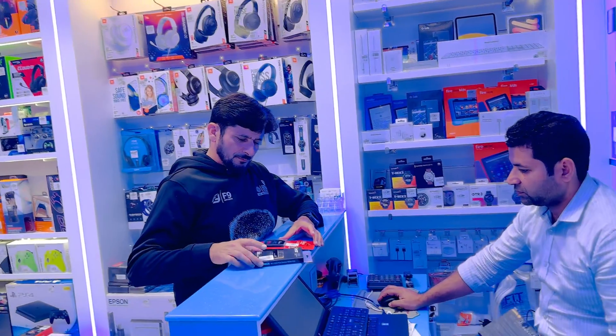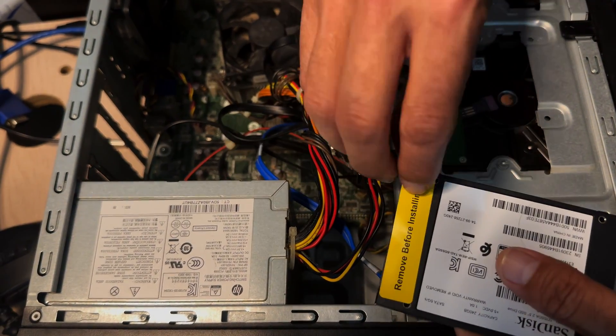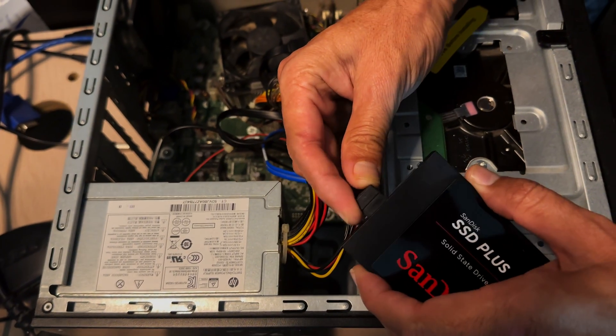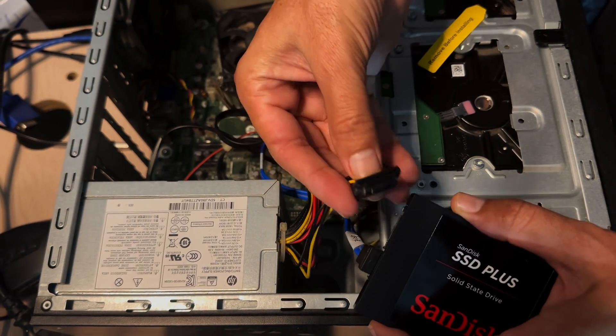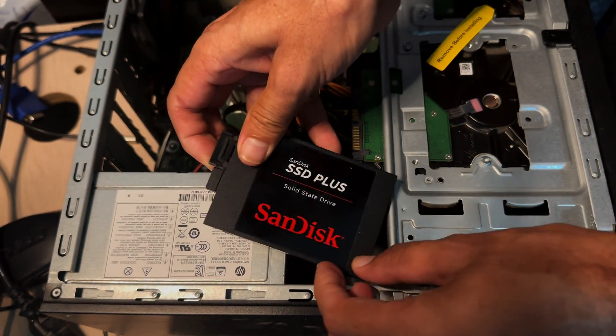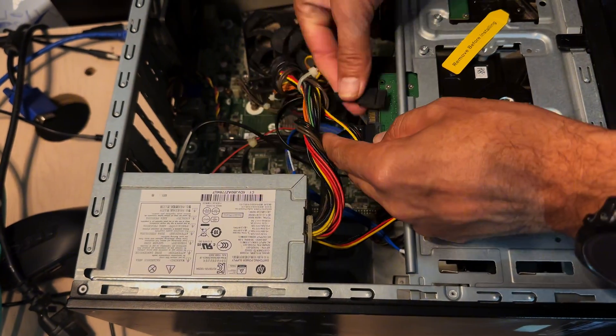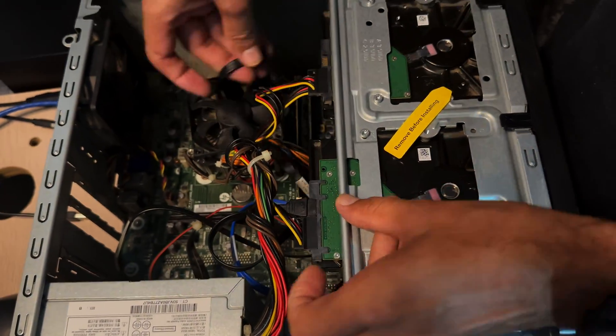I have old hardware here that I had to prepare. It's a 64-bit system with a two-core CPU. I have 12 GB of RAM available, but the SSD was missing so I bought one. I'll be using the SSD for the TrueNAS Scale installation. Only three SATA ports are available — two for storage drives and one for the installation SSD.